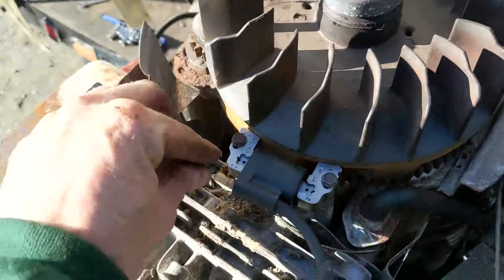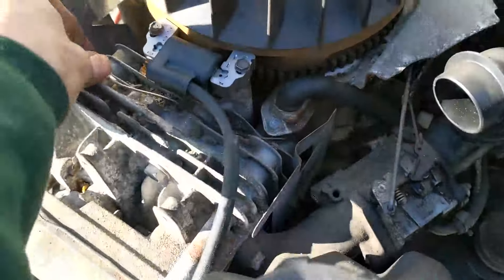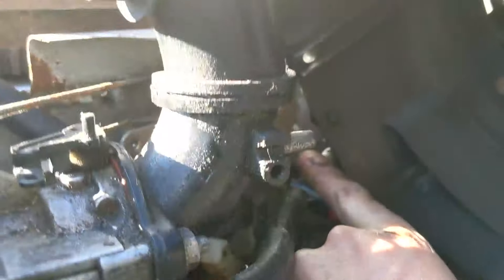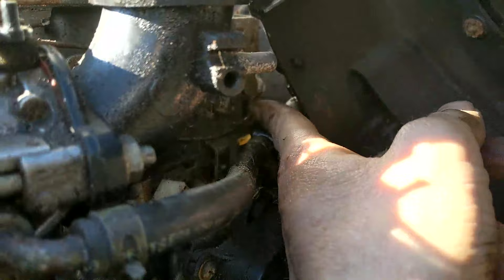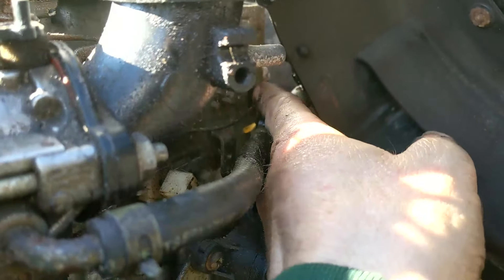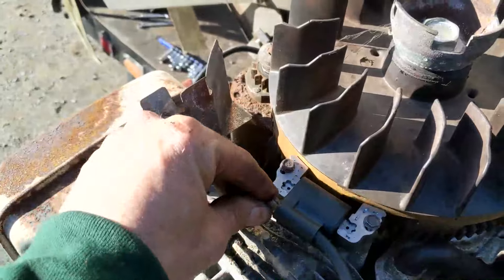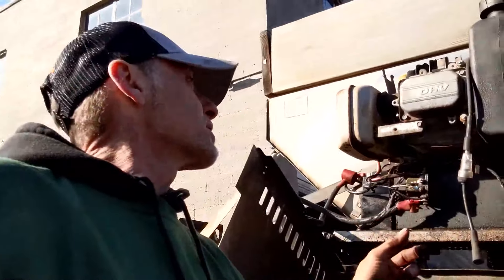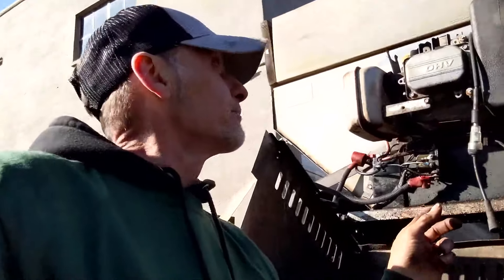If your machine is still not starting after you put the coil in, pull this wire off — I bet you it'll start. A lot of times these wires go bad. It runs down the side here and connects to a bolt way back here. A lot of times these get really frayed or brittle right there and they're not making good contact — that could be your problem. Pull that wire off and see if the motor starts. And that is how you change the ignition coil on your 10.5 horsepower Briggs and Stratton 344cc. Please hit subscribe below, give me a thumbs up — I'll see you next time.